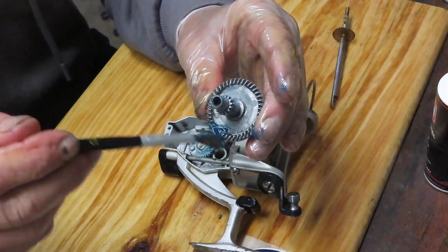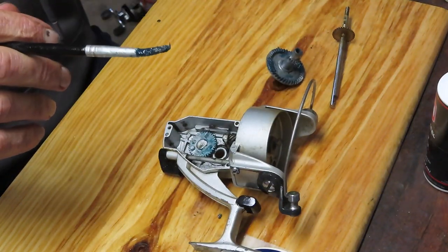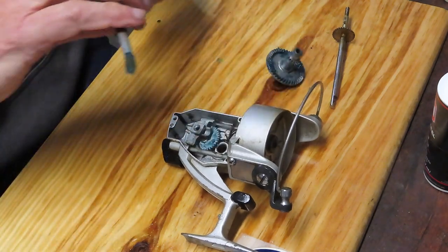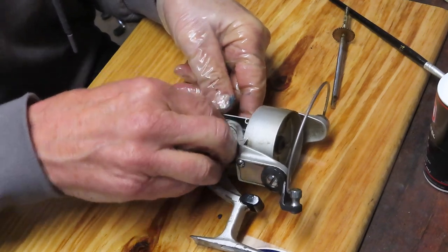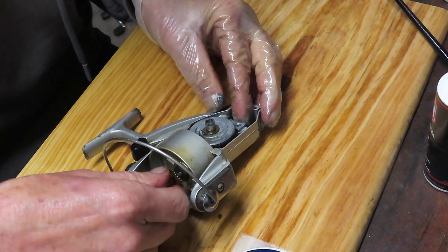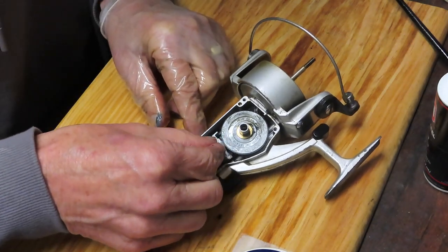You want to get the grease onto the teeth of the main gear itself. Generally I like to put it in four spots on the main gear and also on the pinion gear — put it on four spots and it'll spread itself around nicely when it circulates, because since one is smaller than the other, all of the teeth will touch all of the teeth on the main gear eventually. This is your crosswind block that goes in next. Now take the main gear, make sure it seats in nicely. Next up is the axle shaft, which goes through the top and seats in — make sure when you do this that you've aligned the hole in the axle shaft with the hole in the crosswind block.